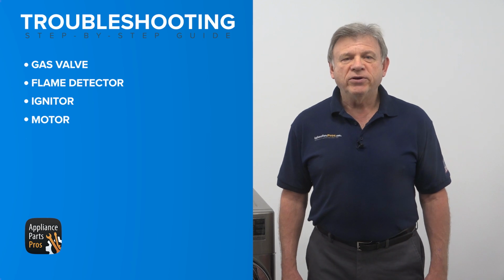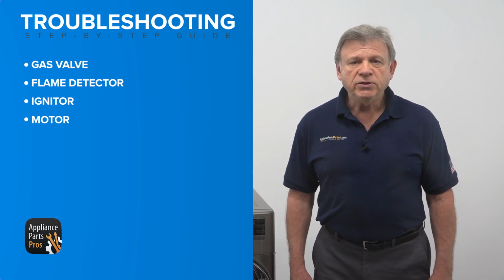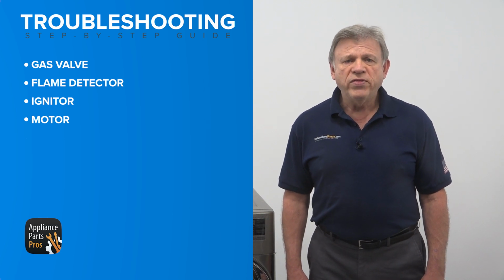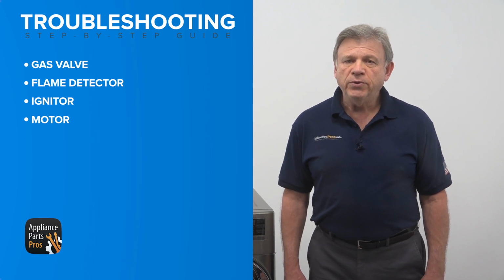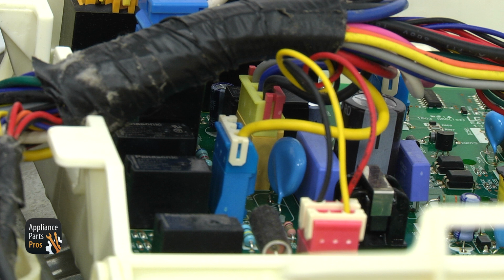The dryer's motor centrifugal switch during the start closes contacts for the electrical path to the igniter and the gas control coils. So without the motor running, there won't be an accidental gas ignition. We need to test if the motor switch circuitry is closed. On the PCB, locate the blue connector with a single yellow wire and the YL3 3-wire connector.